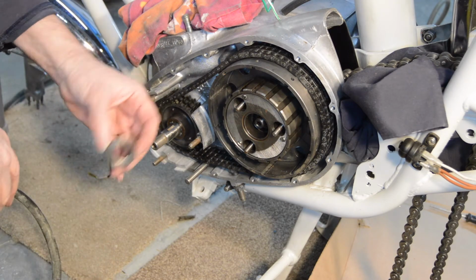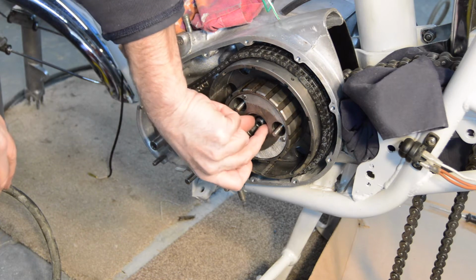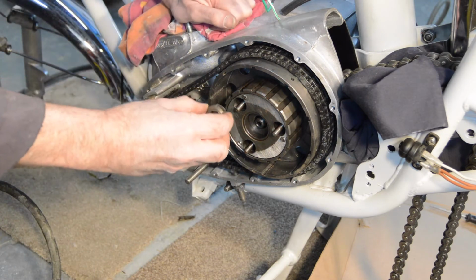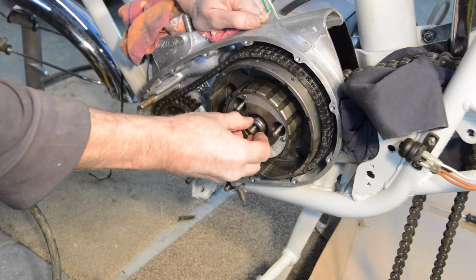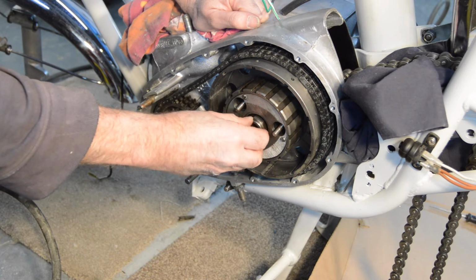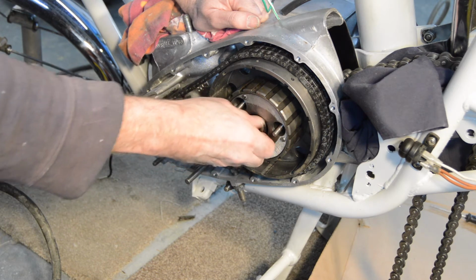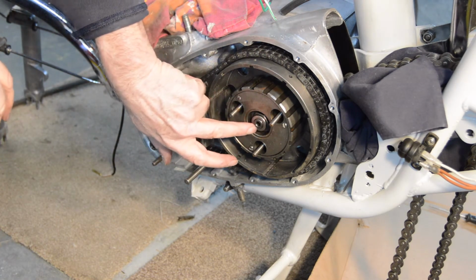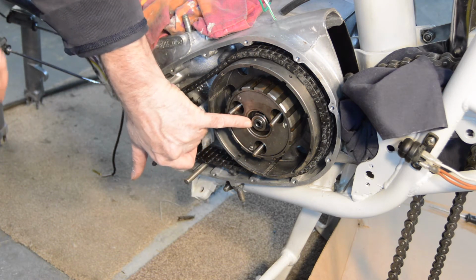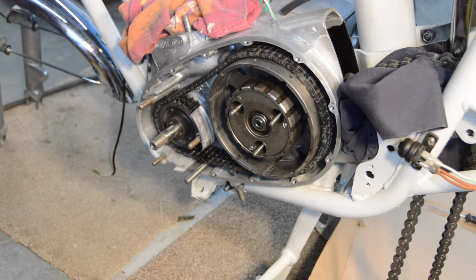And then there's a spacer, which you saw me pop on there by mistake earlier. Don't know what I was thinking about, but anyway, there's a spacer. And then our locking nut. Okay, it wasn't seated fully on its spline before I put the nut on. So anyway, the washer's in, the nut's on, torqued up. So then it's fit the plates, which we have to one side.